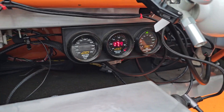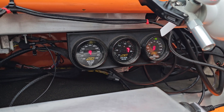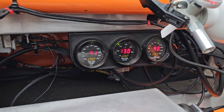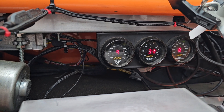You can see, you can make out the oil pressure. It's about 85. It looks up to high 80s. It's a little above idle. You can see the air/fuel drops down. Temperature's starting to climb up.